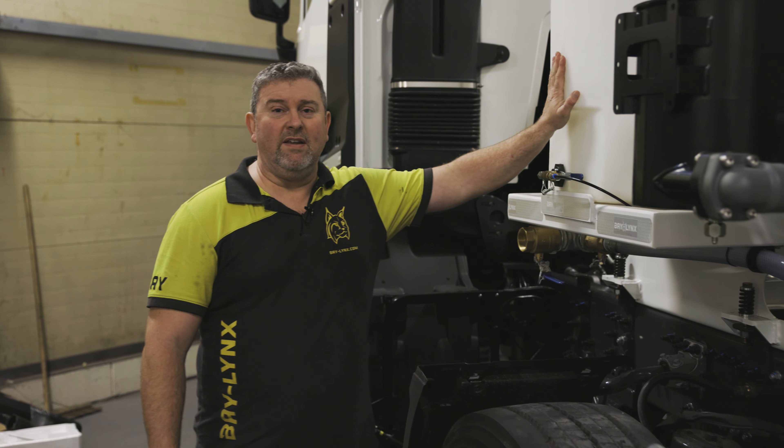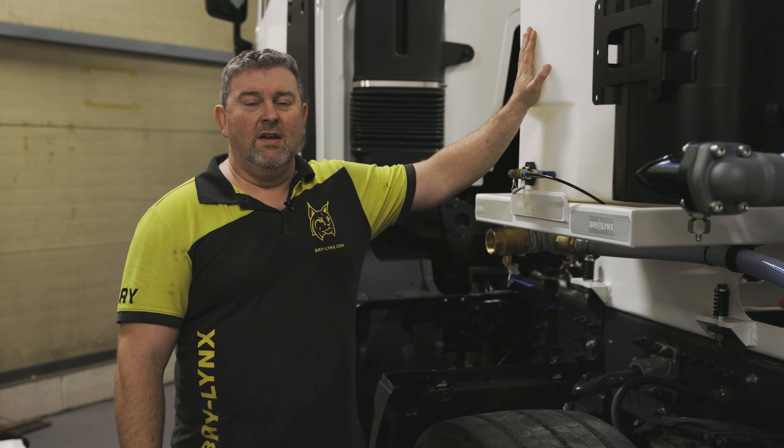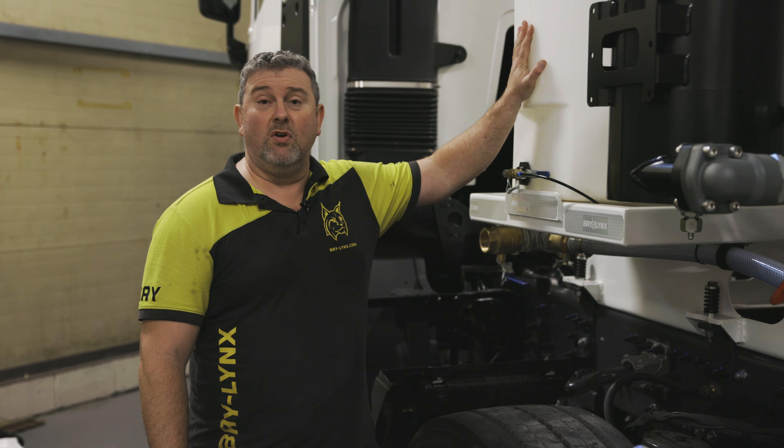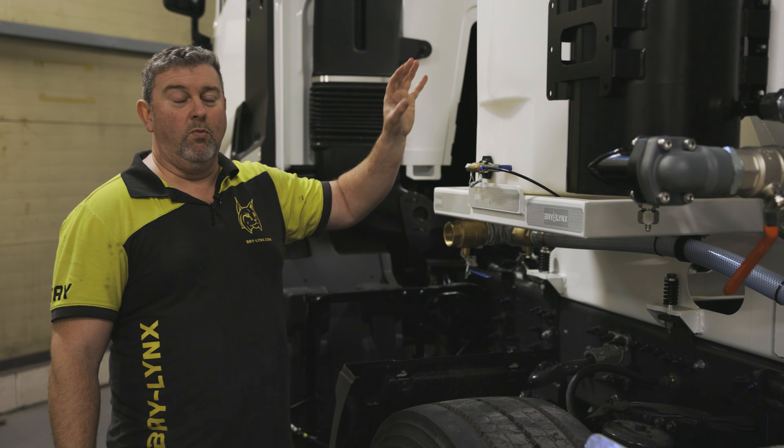First of all, if we look at our water tank — if it's going to get very cold, we're going to completely drain the water tank. That way we've got no danger of the whole thing freezing. If it's only going to go zero, minus one, minus two, we'd be good to leave the water in the tank, but we do need to turn the water supply off.